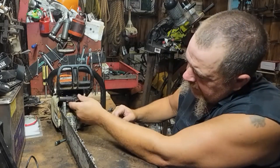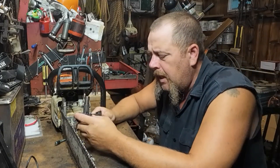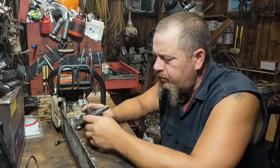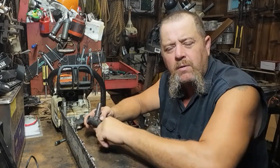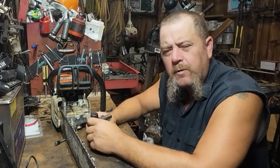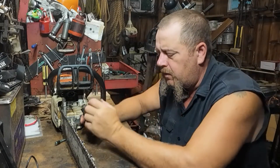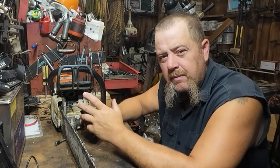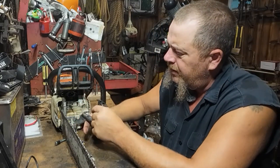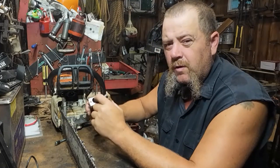You've got to get that angle right so it'll fit, and you don't want to stick it out too far where you can't work with it. He's given us general guidelines for how to build it for a 70cc saw. What we're trying to do here is run them on a dyno and see where we can get some power. There are some neat things happening — we get a real neat wash pattern, and as I move this stinger, it's changing the wash pattern inside this pipe.